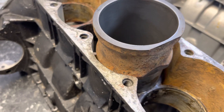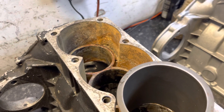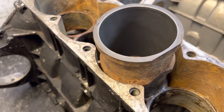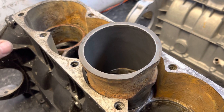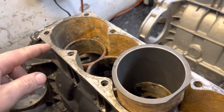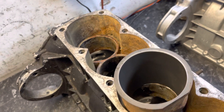If you've ever looked at a racing IMP engine, you'll see on the thermostat housing at the back there's a little bleed that goes back to the header tank from the coolant jacket. That's because they realised that every now and again these rings would leak a little bit if the engine got warm — the warmer it got, the further the head grew and took the pressure off the sealing ring. So they had this little bleed valve system running to the header tank so the engine would never airlock, because a lot of them had front rads and the pipe would go downhill, so you had to remove those air bubbles.